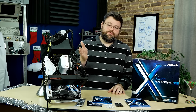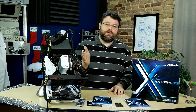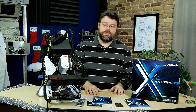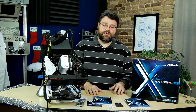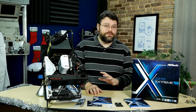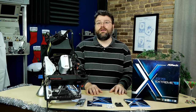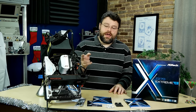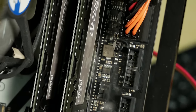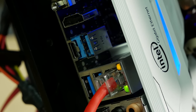You can run x8/x8/x4 like traditional motherboards, and you still have all your M.2 and SATA connectivity. Curiously absent is SATA Express — that's not something that really caught on in my opinion, and I do not see it on this motherboard. It does have two USB 3.0 headers on the motherboard, which is nice, and the ASMedia USB 3.1 at the back panel.